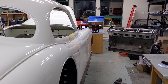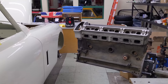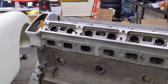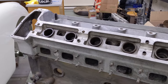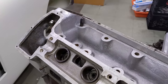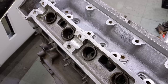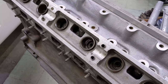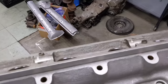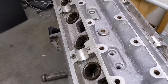Okay, that does it for this episode of the XK Motor. Thanks for watching everybody. Here you can see a different phase now where I've cleaned the motor, cleaned the head, ready for the machine shop. I like to get these things really cleaned up as best I can before they go to the machine shop. This cylinder head has been walnut blasted after it went through the parts washer with mild phosphoric acid - cleans it all up. This thing isn't painted so I really want to get that aluminum shining bright even before it goes to the machine shop. Do I hope we can save this one - it's definitely been warped and decked so it'll be a bit of a challenge, but I think we can do it. Keep the car matching numbers - keep the block and head together after 70 years.